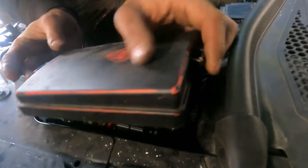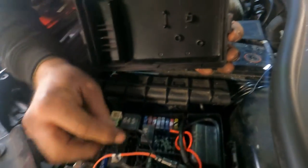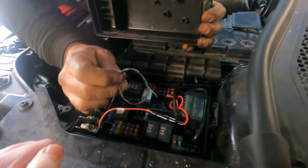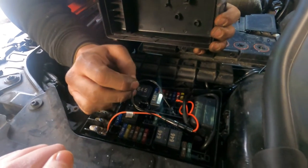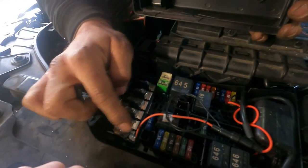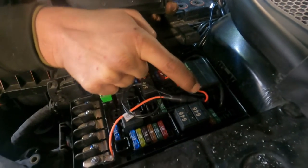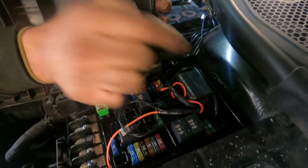And then the whole electronics actually fit in here, so that's the remote control stuff. All connected, and basically that's the stuff that activates the override here. Yep. So this, rather than being just a coiled up wire, is the antenna for the remote control. You've got a power feed coming off the permanent lives at the front of the fuse box. You've got an inline fuse for safety. And then the control box basically operates the solenoid valve.